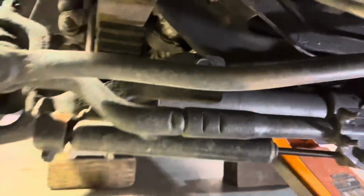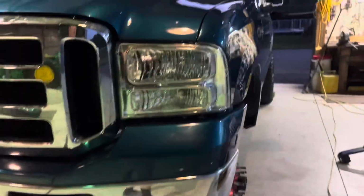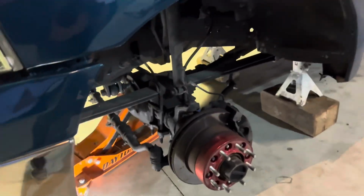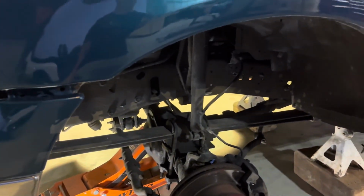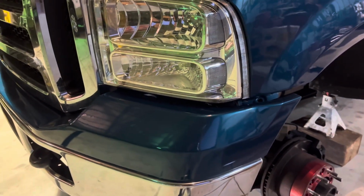And this is important to do this first. I probably should have done this before I put this on jack stands because there's going to be so much prying, and hopefully it's not sketchy, but that's going to have to come out, otherwise the axle's not going to want to move for us. And Rough Country sent us one with the kit, new one that should be a different length, and I actually am going to be using a 1 3/16 because I don't have a 30mm socket, but it technically is a 30mm under there if you're wondering.